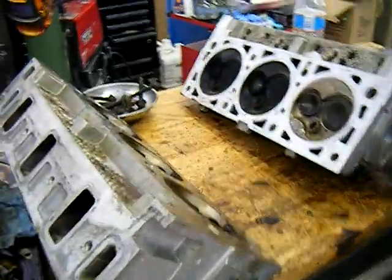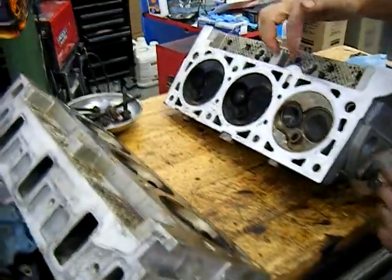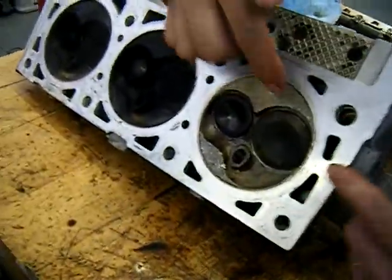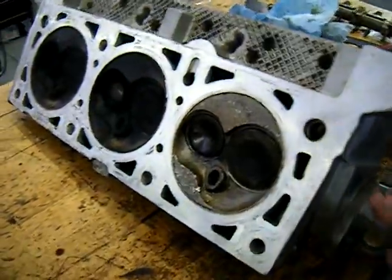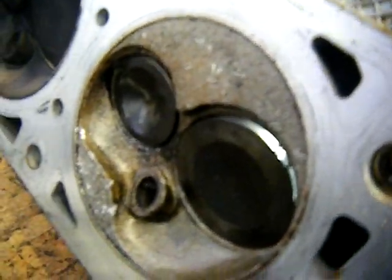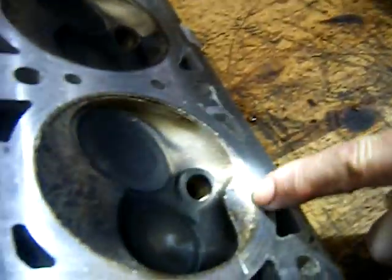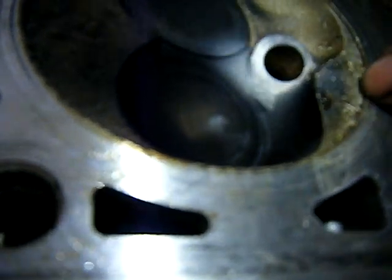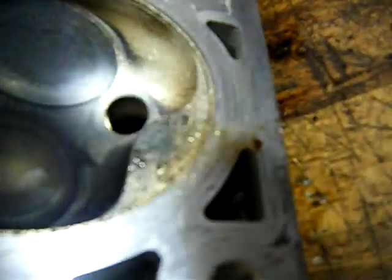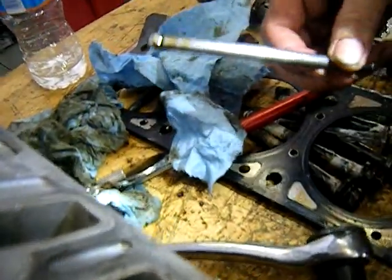And I think this is where it came from. Up here on the bench we have the cylinder heads as we took them off — this is the passenger side, this is the driver's side. This is the number 5 cylinder, and this is what we found. It's got a bent valve, and you can see damage right in here. You can clearly see there's a bent valve there, while the other ones show absolutely nothing. It's also transferred over onto this side — you can see actual divot marks in the cylinder head. The valves are not bent on that other side. What I also found is a bent push rod.